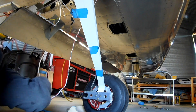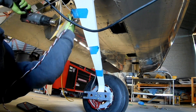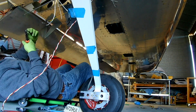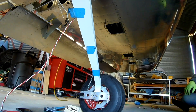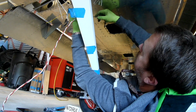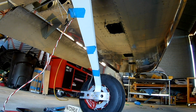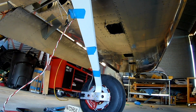You can see the red and white wire twisted pair hanging down — that's the wire that goes out to the pitot tube. The thing I haven't decided yet is do I plug that pitot wire into the main connectors that Vans wants you to use, or do I keep it separate? Vans designed this with connecting spots up front by the wing root for big Molex 12-pin connectors, which is all fine. The problem is, maybe I need to disconnect my pitot for some reason and I don't want to disconnect everything else in the wing. This is a small wing — it's just lights, pitot tube, and outside air temperature probe. It all fits in one connector, so we still haven't figured out if we're going to do it or not.